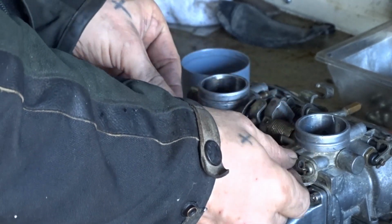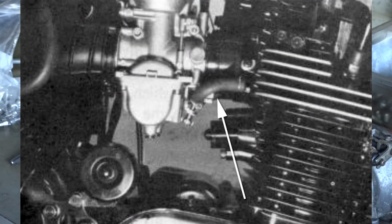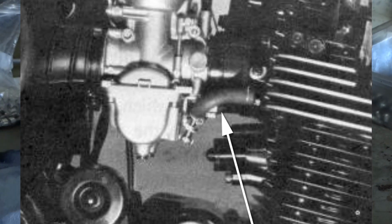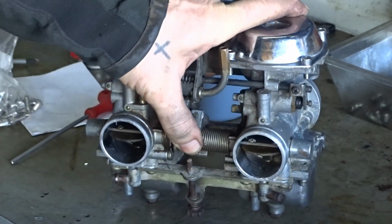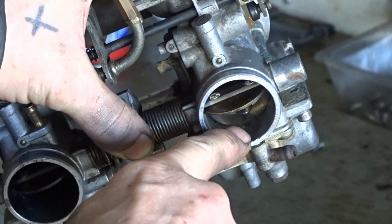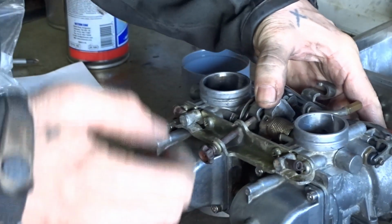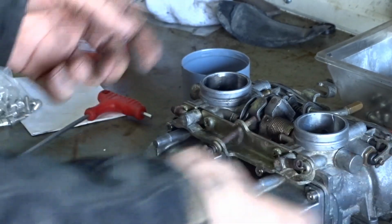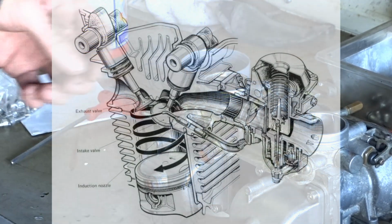You've got two tubes that actually come out of there and go into the head, and what they do is suck fuel in from a little tiny weeny hole. You probably won't be able to see it, but just inside there is a little teeny weeny hole. Air gets sucked through the tube and goes into the head, and when the valves open, the air that comes through these tubes creates a sort of whirlpool effect inside the cylinders.